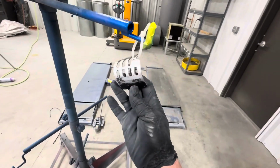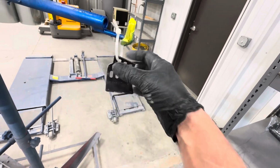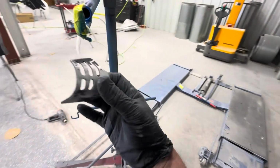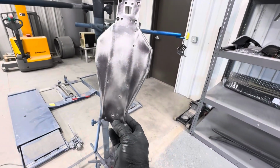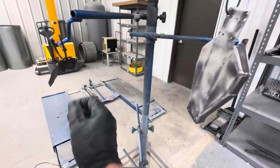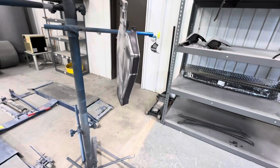It's going to get scratched. There's the motor guard, just a little bit of glaze in the scratches. We'll hit that with some primer, not much. You don't want a lot of buildup, because if you put too much buildup on there, when you put your screws back in, that's going to turn the paint off. So keeping the minimum mils on this if we can.